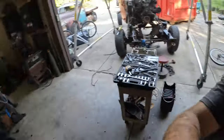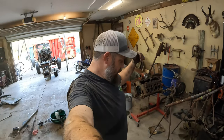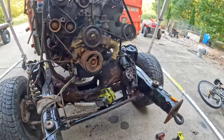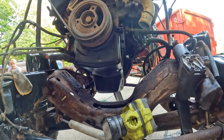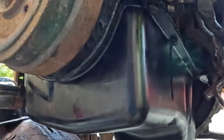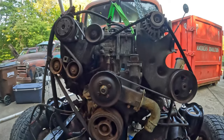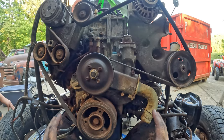I'm going to get the new oil pan unboxed. Caitlin had activity at church tonight with youth group, so she took off. I'm going to prep this new oil pan and work alone with an engine suspended two feet in the air — should be fun. Oil pan's back on. I was already putting down a bead of silicone when I realized I didn't have my camera running. The formula: way too much is just enough. You want a little bit squeezing out around the edge pretty consistently all the way around.